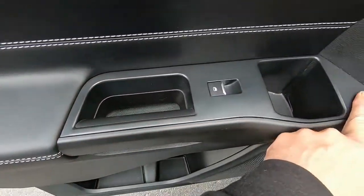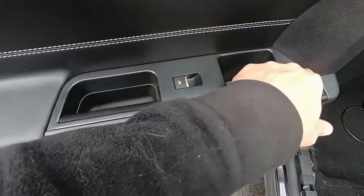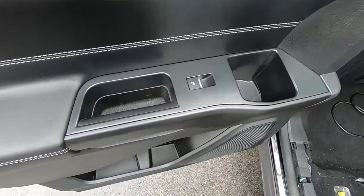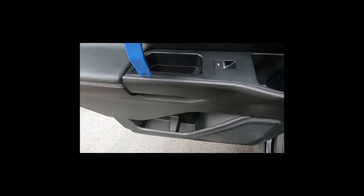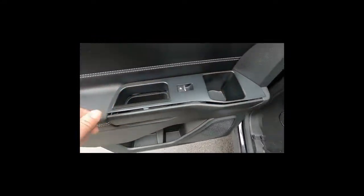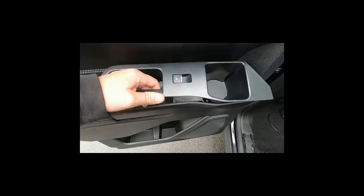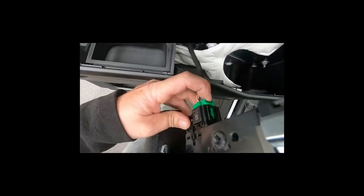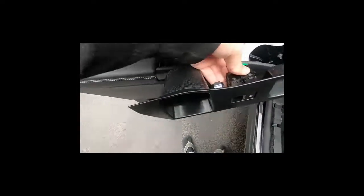The second thing you want to do is remove the cup holder insert. It's just held in by little tabs — there are two tabs there, one there, two on the back, one up here. Once you get these two popped out and the back one popped out, the whole cup holder insert will just pop straight up. Just don't pull too hard, because there is a plug attached to the bottom of it for the window switch. Once you get the side and the back popped out, it's pretty much just lift right out, nice and easy. You've got that plug right there — disconnect that. Press down on the release tab and pull the plug that way. It'll just slide right out and the whole cup holder insert will come right off.